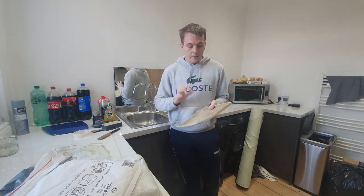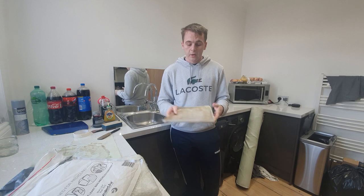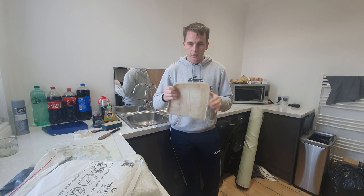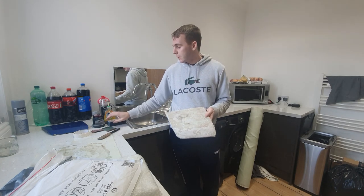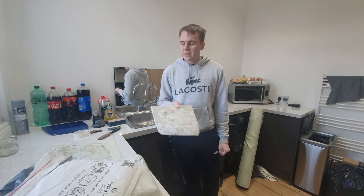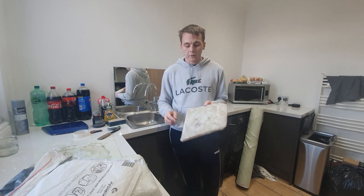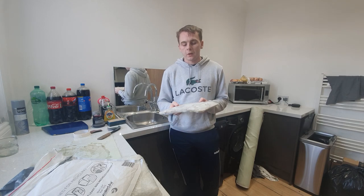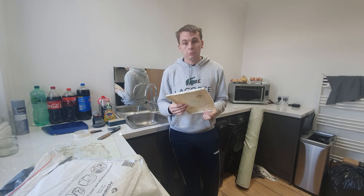Since picking off the last time I've actually put a second layer of glass fibre on — it was the exact same process as before, but I've applied it to the inside this time. As you can see it's shiny, and I've gone over it with 60 grit sandpaper and just gave it a light scuff — just your basic prepping stuff. It's still got quite a lot of bumps but it still will need a filler because it's a woven material — you can see every single bump — so it needs a thin skim of filler over the top.